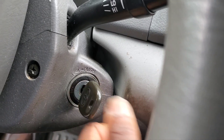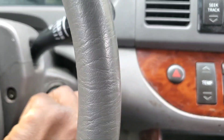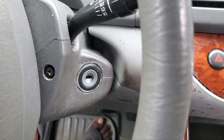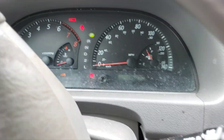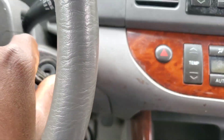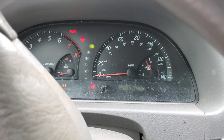Start the car and the car is done. So we have two keys — this one is good, it's perfect, it works fine. The other one also works fine. But this car has an O2 sensor code — now we changed the computer, we don't need anything else — but this car has 20 codes, it has an O2 sensor code. I hear the muffler has a leak, and if you have a muffler leak it will kick up the O2 sensor code.